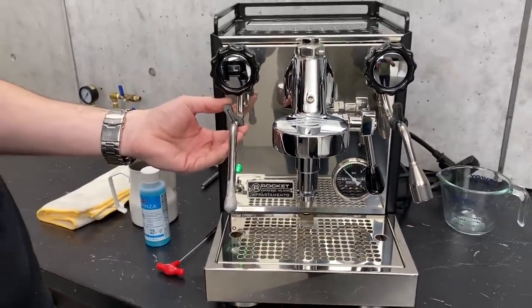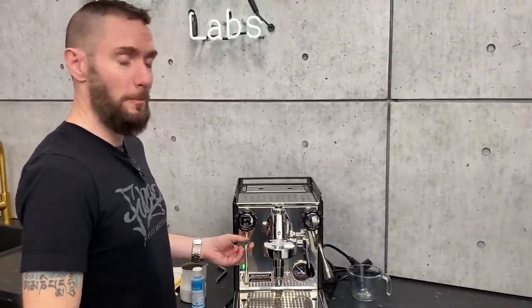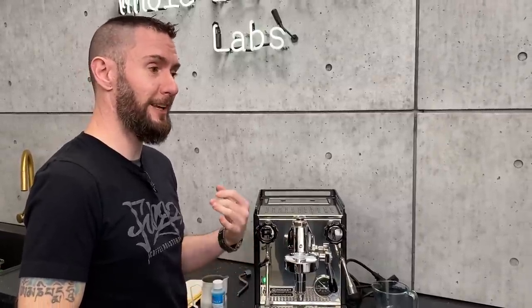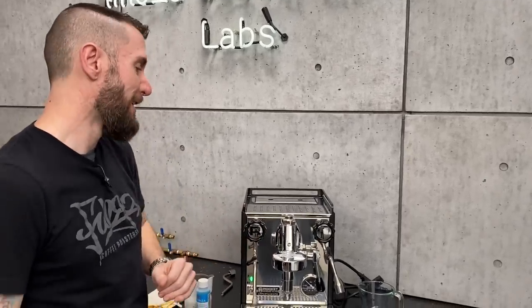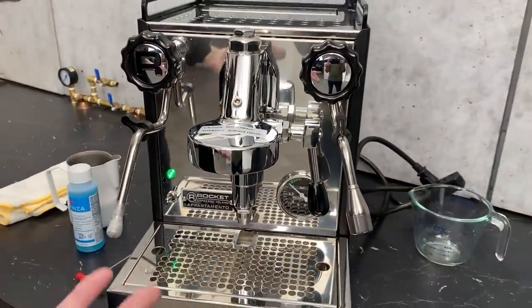That's not really all that bad. I've seen some very amazing things doing commercial work for many years before coming to Whole Latte Love. You mentioned skunky boilers — skunking a boiler is a whole thing. It's a very specific sequence of failures in the valve and on the boiler that creates a siphoning effect that can pull milk from the pitcher back into the boiler. Very, very rare, but you can get a similar situation where your wand will end up stinking because it's not properly being cleaned.